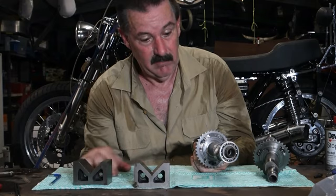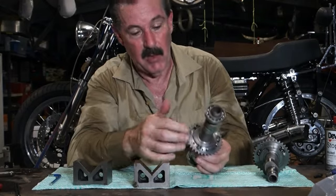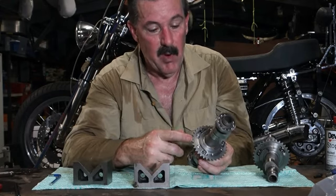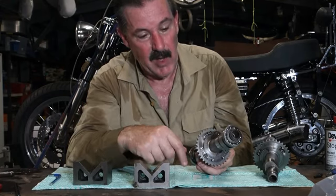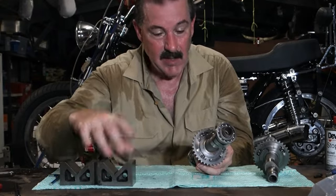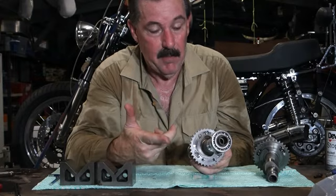That's about all you can do to a camshaft, I think, is have it ground to the grind that you want, have the adjustable sprocket put on, and make that slight modification to enable a future change of timing to be easier than it would have been, and if the engine is rephased, balance the cam.